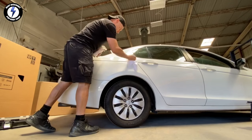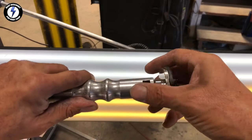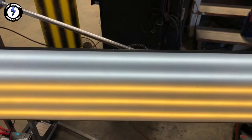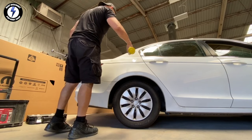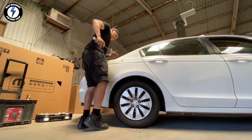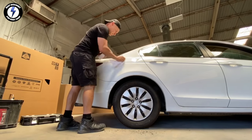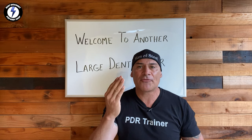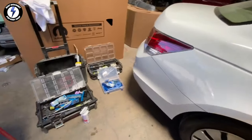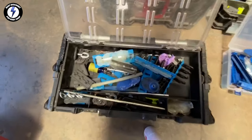Now I'm going to begin step number three — I'm going to try a round with the cold glue method. These tools are great for popping out easy, shallow dents. I'm leaning into the panel, giving the tabs a twist and a push, then several strong pulls. Tip number four: warming up the panel before placing the cold glue tabs will help the tabs adhere better to the panel. After cleaning the panel, the shallow dents did not release.